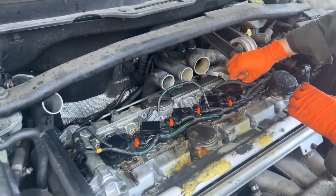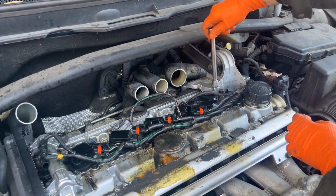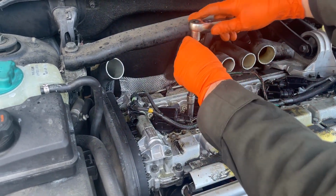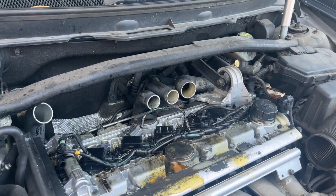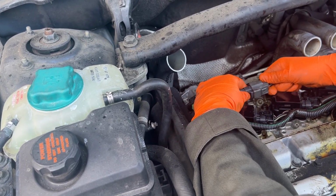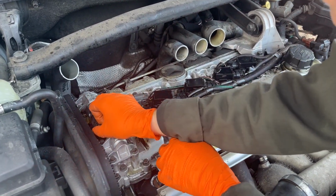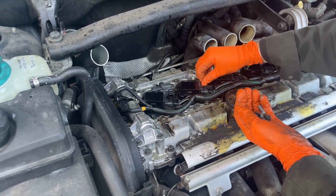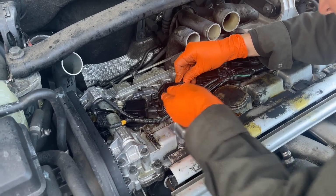Let's start it with my fingers. Past hand tight, which is 5 to 7 foot-pounds. So that's tight, dink, okay. So that's tight, dink. Sound effects help, trust me. Yeah, definitely. Okay, so let's put this guy back in. Okay, and then that one, this guy. To kind of start everything before cinching everybody down, because that way, if something still needs to wiggle, it can.